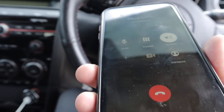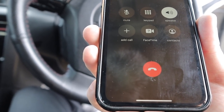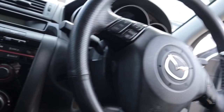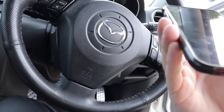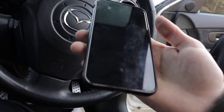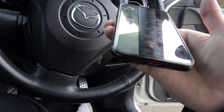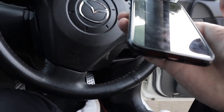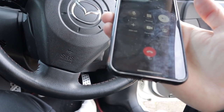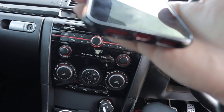Let's get some boost. Hello again. Hello. You all right, mate? Yeah, not bad, you? I was talking to that guy the other day and he said you can take the steering plastics off and unplug something and it then de-restricts the boost in first, second and third? Yeah, so basically that's your steering wheel angle sensor, you unplug it. The traction control won't work when you disconnect that. It will de-limit the first three gears. What I know is find a live wire in it and put a switch in between. Right, okay.